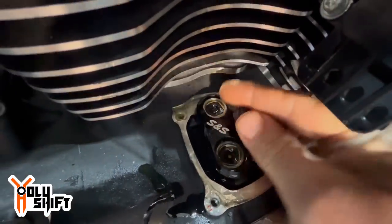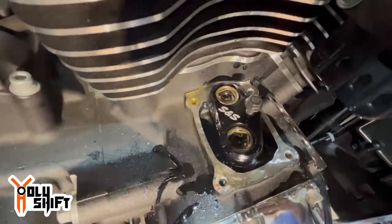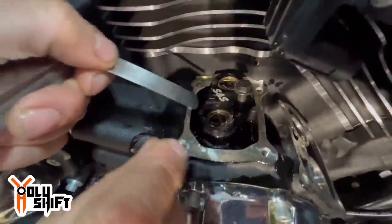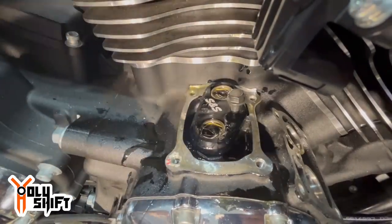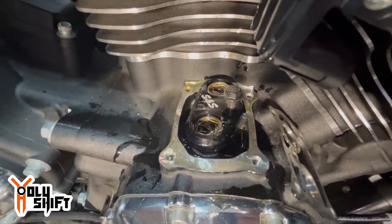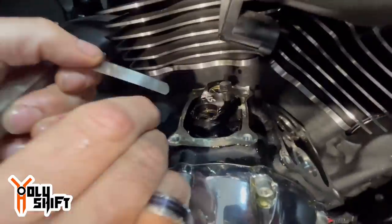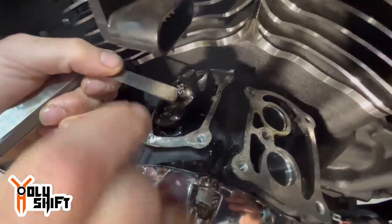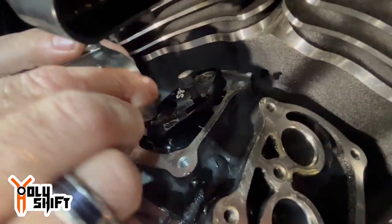And we need a 2/1000ths of an inch gap between the metal and the tappet. And I have the feeler gauge right here. What does that mean? Explain. This can't be hitting the tappet. Because it has movement, it can't be hitting. So there's got to be a gap, and the gap is 2/1000ths of an inch. So we put the feeler gauge in here while we tighten them up, and it creates the right gap. If you think I understood what you just said, you're wrong.